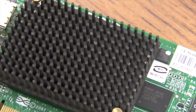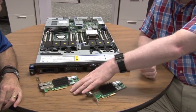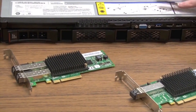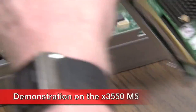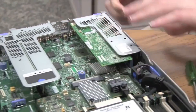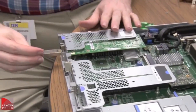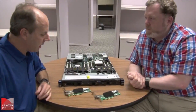So those features are new just on the 16-gig adapter? Yes, the card has been shipping for a while now, but it was a new software update that coincided with the Grantley launch that added those two new capabilities to the 16-gig. But both adapters work on the new servers like the 3550 M5 and the 3650 M5 we just announced? Absolutely. They are still PCI Gen 2, but even with the new Gen 3 slots, they're fully backward compatible. There wasn't really a requirement to go Gen 3 with these platforms, so we kept them as they were.